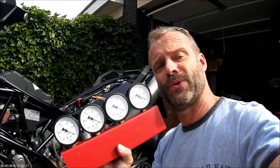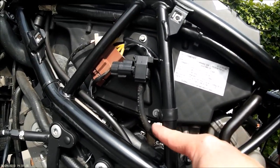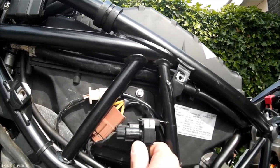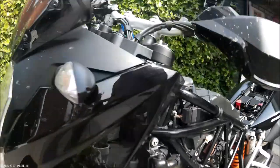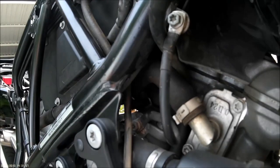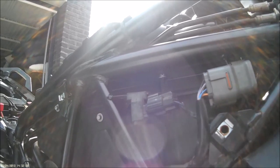Synchronization meter ready. Where to connect the hoses — very simple. First one for the rear cylinder: plug in here. This hose goes to an intake sensor, probably to measure temperature. Pull it off and connect the hose from your synchrometer to this port for the rear cylinder. For the front cylinder, there's a similar tube sitting on the intake manifold on the throttle body, lower part, going to this sensor here. Disconnect it and connect it to your synchronization meter.